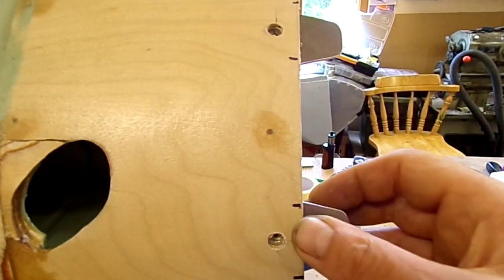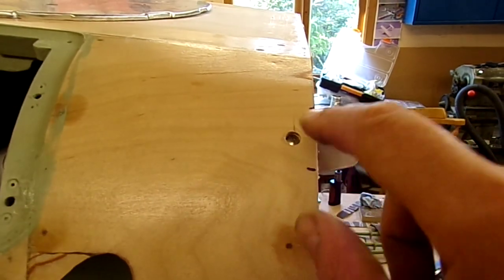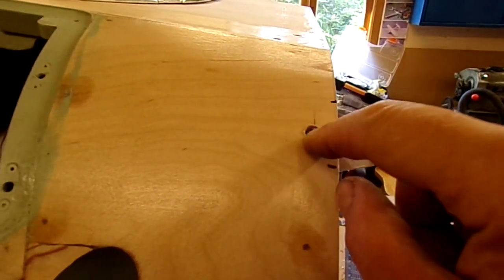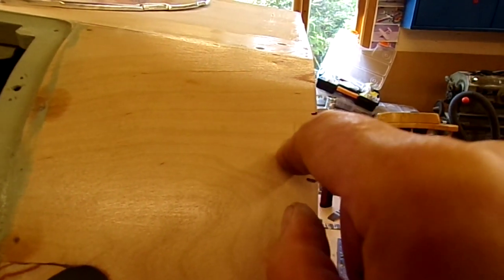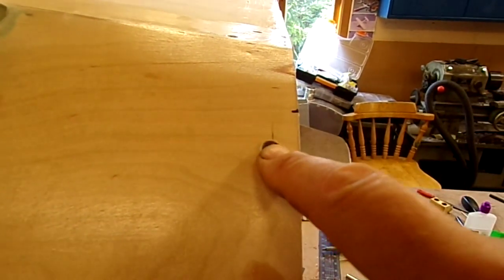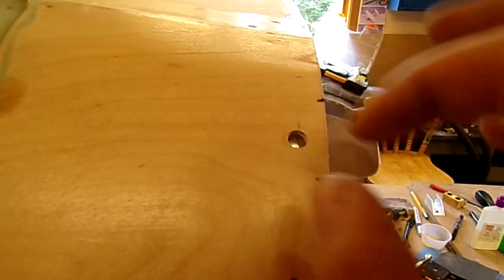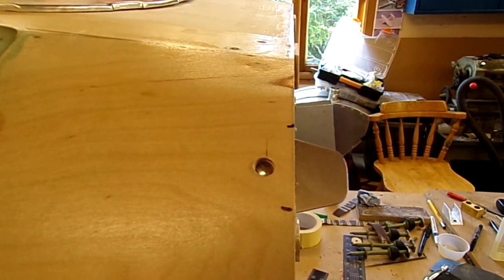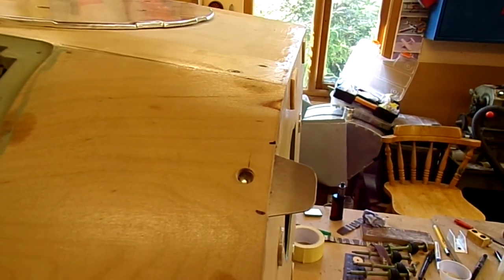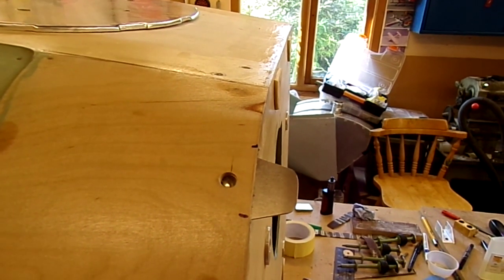This will all be wet assembled with epoxy, then the top will be covered with the epoxy and wood flour mixture to smooth it off, because these should never need to come out again. It'll help to secure everything — glue holding the aluminium section in place, screws going in with epoxy on the thread, and then epoxy over the top to locate the head as well, so there's no way that's going to come loose. It'll be a right pain if it ever needs replacing, but that's how it's going to be.